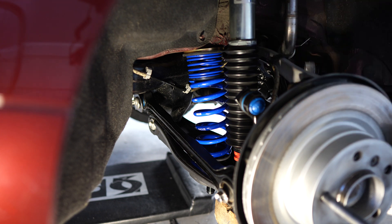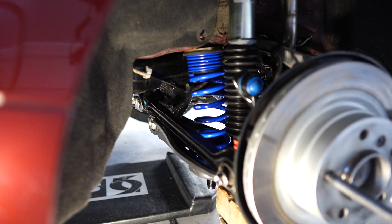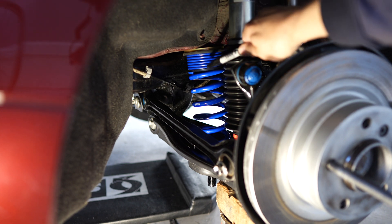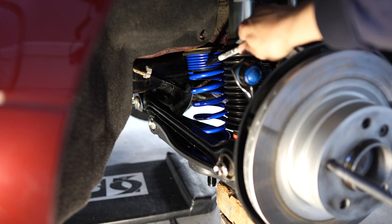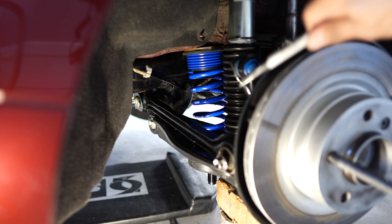The helper spring is not collapsed right now, but its normal working position is a 100% collapsed state. I'm going to demonstrate how that works: if I make the suspension go up, you can see that the helper spring collapses — at this point it's completely collapsed, there are no gaps between the coils. This is called the collapsed height of the helper spring.